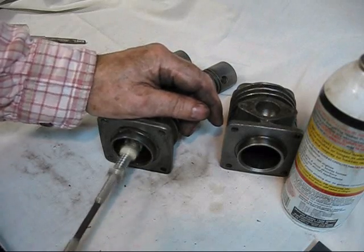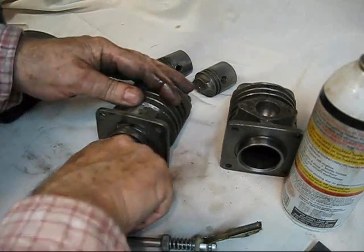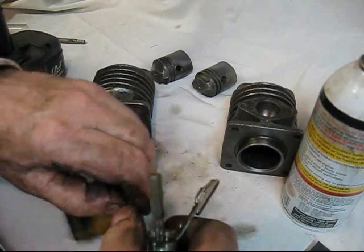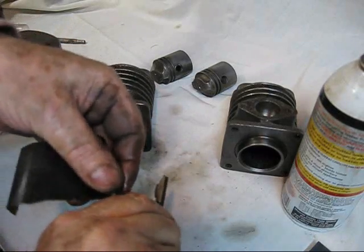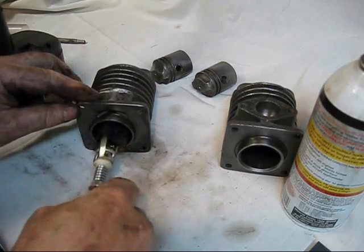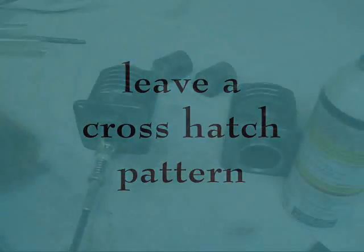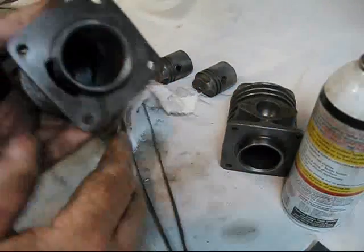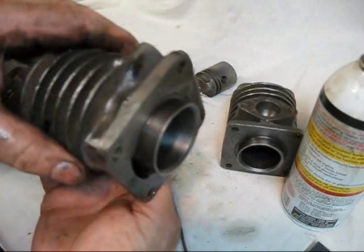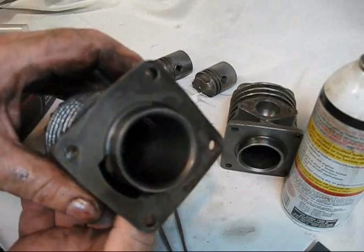Alright, just watch this — just how much it takes. My paper got off the stone, so at this point we have to get it back on. I do not want to use the stones on here — it's just a little too aggressive. This is actually a brake cylinder hone that I'm using here. That's worked on enough. Looking down in the other cylinder, I can see a dull finish all the way around. I cannot get the camera angle on that, but there is a dull finish, and I do not want to take any more off than is required.